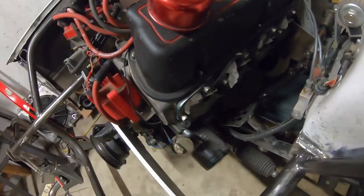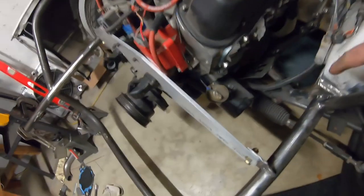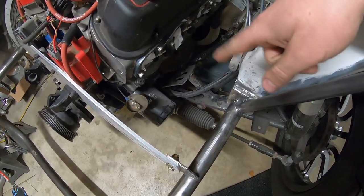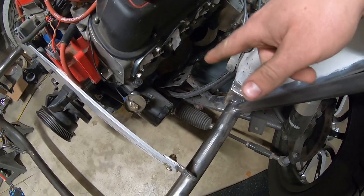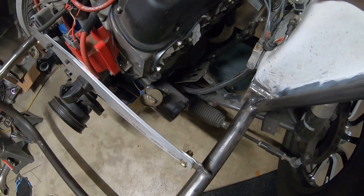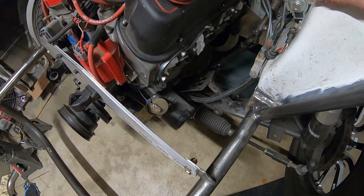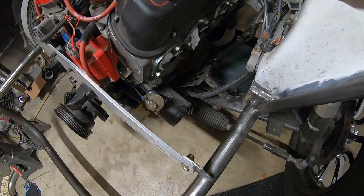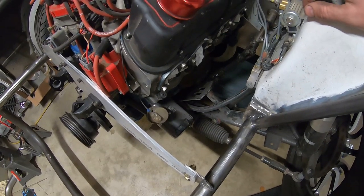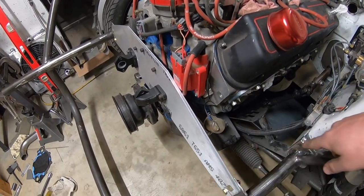I got my new head flanges in for the Trick Flow high ports. I can't decide — this came with obviously stock location motor mounts, those little pedestals or pads. The best bet for me to make long tubes is probably cutting those off, but I don't really want to do that because I always like the ability to go back or to sell this thing. What I want to do in the long run is put in one of those outlaw K-members with a stiletto rack where the K-member comes way out here so you have tons of access to your oil pan.